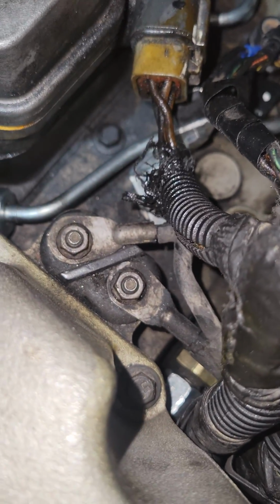And real quick, if you're struggling to get the wiring harness loops or holders on the actual air horn, the injector harness goes first. That's the middle one. Then it's the MAP sensor and rail pressure sensor. And then it's the air heater grid that goes on there.